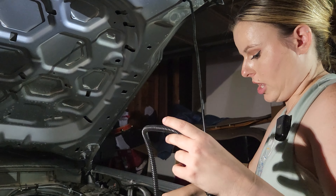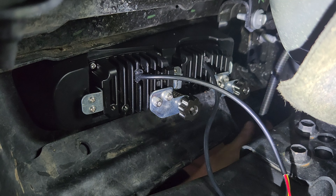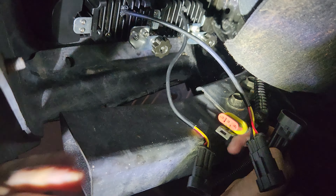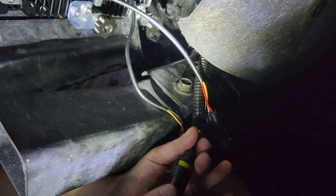Let's tuck the wires through the back — there are adjustments here that we're not going to mess with right now. There's actually an audible click when they pop in. This is a cord I need to feed down through the engine bay to the lights — one side needs to get to the right side and then snake over to the left side, basically under the frame but still in the bumper. We made a mistake by following the instructions in order — in reality we probably should have dropped the wire from the top first and connected everything, then installed once all the wiring was done.